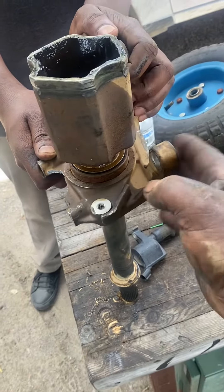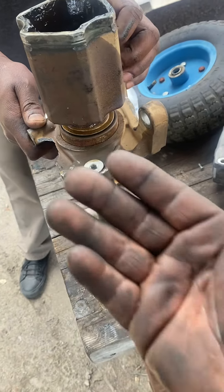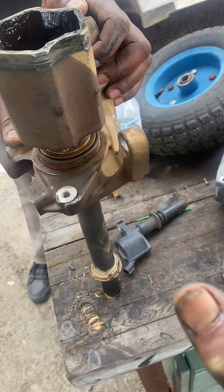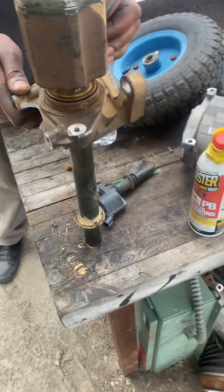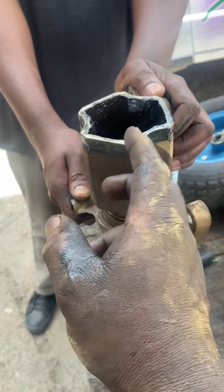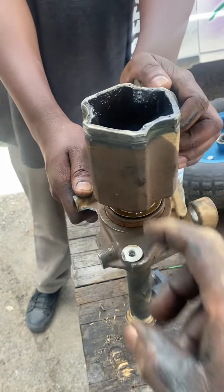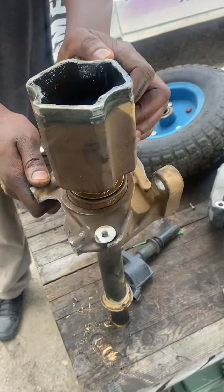You can remove the whole housing and the axle out. When you are pulling it out, you just need to move this piece away from the block and pull it out straight — it will come out straight. Once that is out, remove your drive axle from this section here, pull out the boot, and the axle will come out. This part of the axle is your CV joint.